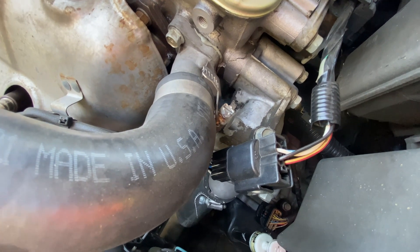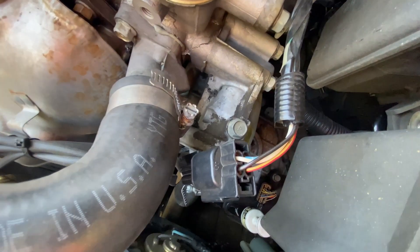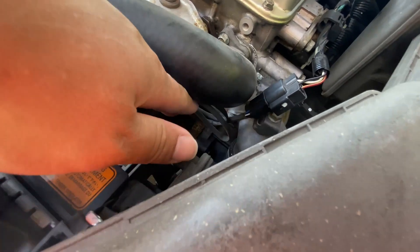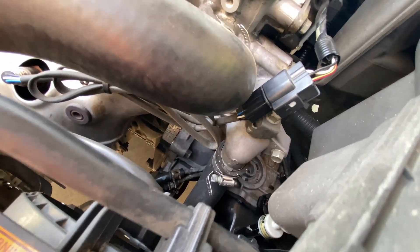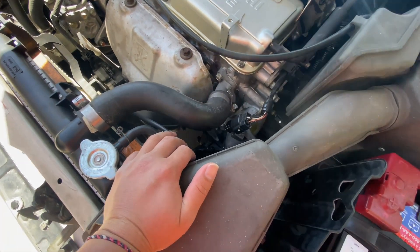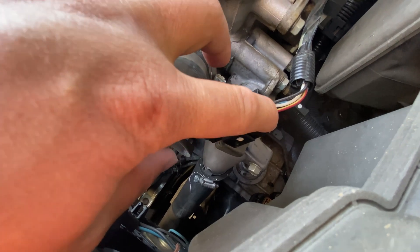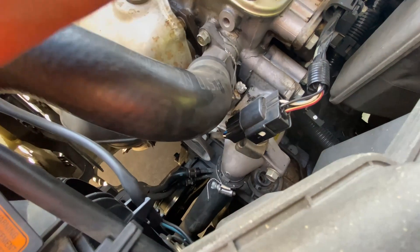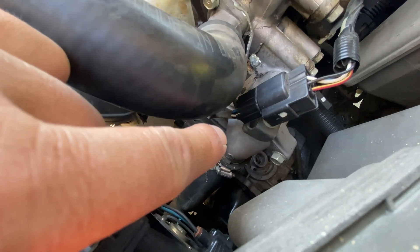So of course I'm thinking it's the wires — something electronic. I started comparing how the front one was wired up. As you can see there's a blue, white, a black, and an orange. But then if you look on this end — the side that goes to the O2 — you can see you have a blue, a white, and basically two blacks. Those two black wires are actually your heater circuit. On this car, the orange and yellow one is actually your constant 12 volt — it only comes on when you turn on the car, but it's your constant 12 volt which is used to heat up the heater circuit inside the O2, which is connected to your black wire going to the O2.